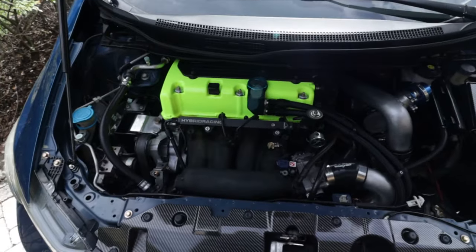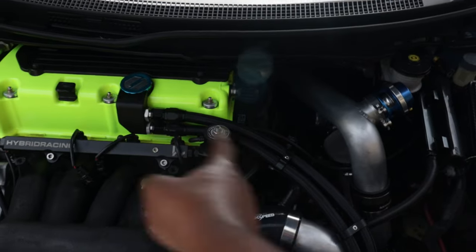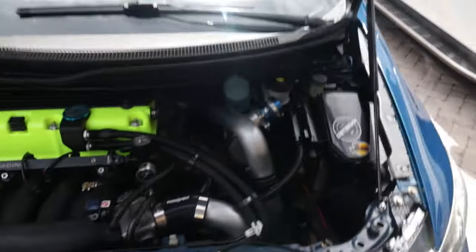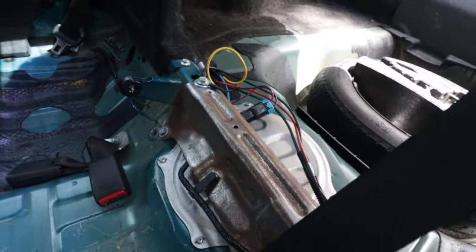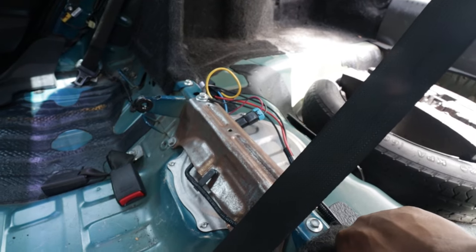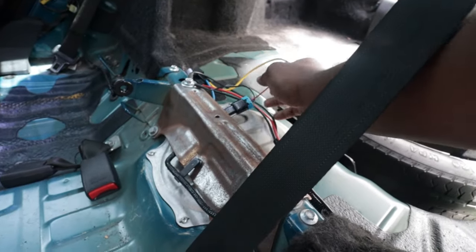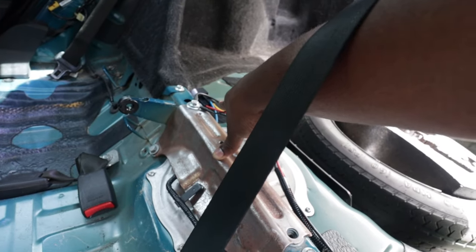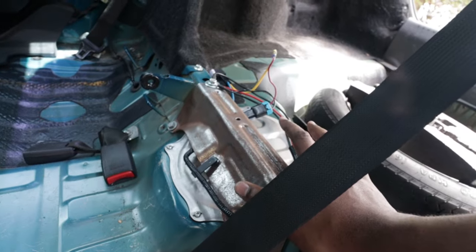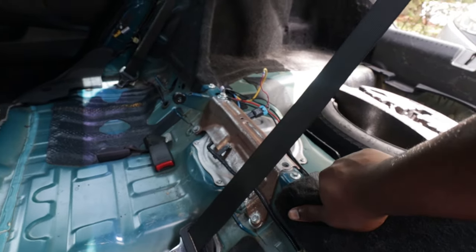This is a new day, guys. Basically done with everything. In the previous clip I showed you guys the new feed and new return setup — everything here is new. Let me show you guys the relay setup in the back. I had to splice and cut a whole bunch of wires, but it was actually very simple. I'll leave a video in the description so you guys can go watch — that helped me do the relay install. It's very simple: red is the positive, yellow is the power to the fuel pump, black is the ground — both blacks are the ground. The blue goes to the signal on your OEM plug, which is the green wire. That's pretty much it. Super easy.